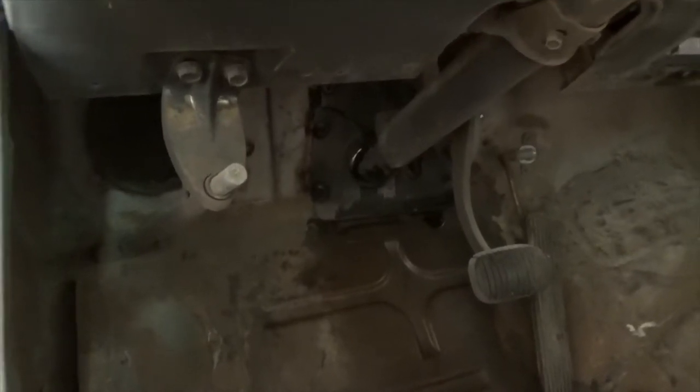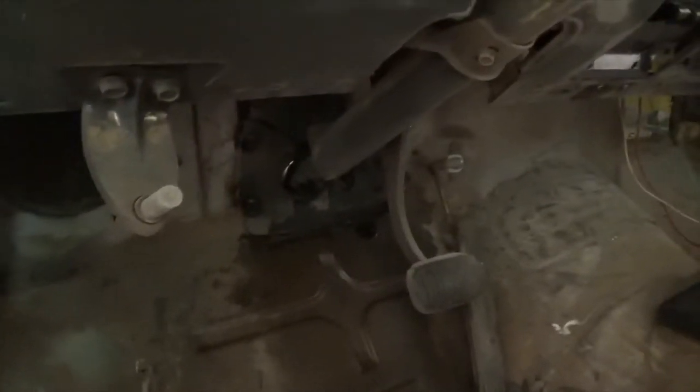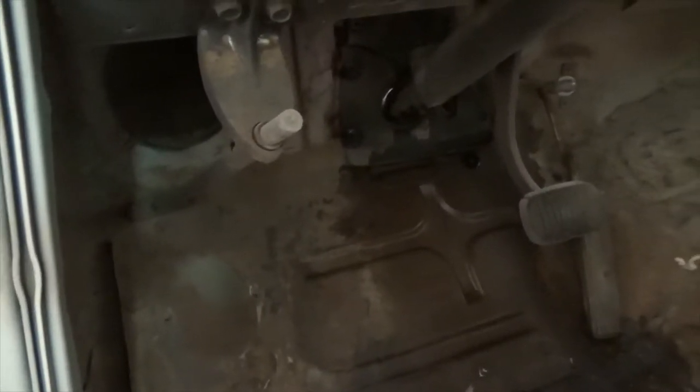When you're doing a wiring job, one of the first things you want to do is determine where you're going to put the fuse panel. On some of these cars you just got to find a location, but you also want to make sure you put it in a spot where you don't have to add anything to the wiring loom. It can be a little tricky, but this is inside the '57 on the driver's side, and we're going to take a minute and locate where we want to put the fuse block. Once we get that mounted, we'll show you that.